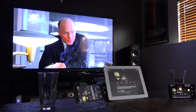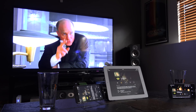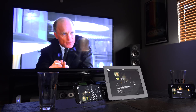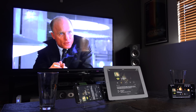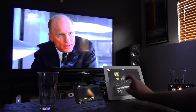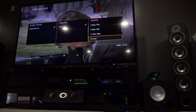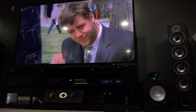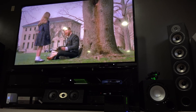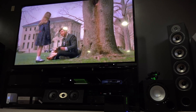What I found was actually a little surprising. I expected to be able to play maybe one video at a time at best, and I almost thought it would have had to be a 720p video and not the 1080p. But during my testing, I was able to transcode the 1080p video to any device in my house at any quality that I chose. When I was changing the quality to something really low, like 320 kilobits per second, it did take a little bit to catch up, but once it got playing, I didn't have any kind of stuttering. I felt like I needed to test it at this quality because if somebody wanted to stream movies or TV shows to a phone or tablet, they might not have the bandwidth to go much higher.